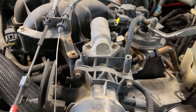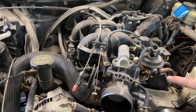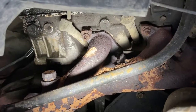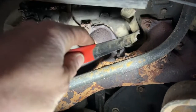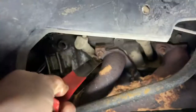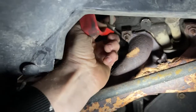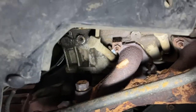The plan is to pull the intake off and inspect the valve covers — just the top of those cassettes. If the cassettes look like the old version or are worn, I'll strip the accessories off the front of the engine and replace them. Down on the side of the engine we've got our spark plug boots. I blow around them to clean off any mud, then I use this little hook tool — you hook it underneath the boot, pull up on it, and it stops it from ripping, which otherwise happens pretty easily.